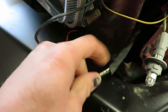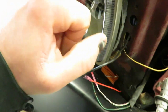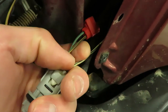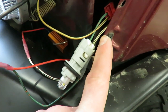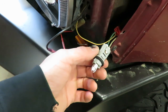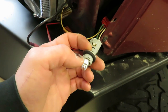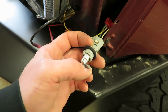So this is the original blinker wire that we went through this resistor for the LED blinker — the one that was in the headlight. What we're going to do is take our side marker light, cut the white wire here, and hook that to the green wire. This is a power, this is a ground, so it's basically going to be a floating ground to power this bulb. If you decide to do this, you need to use a halogen bulb — you can't use an LED bulb with this application, because the LED is a polarity-sensitive bulb, meaning it'll only work if you have the correct side to positive and the correct side to negative. If you flip this bulb around, it won't work.